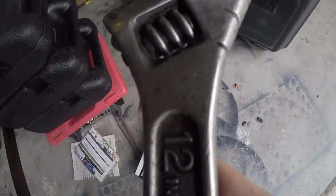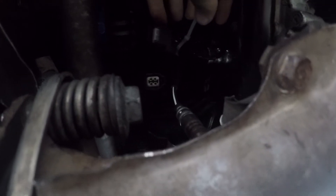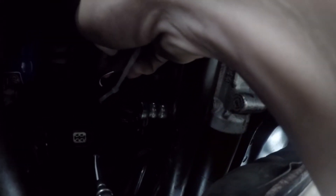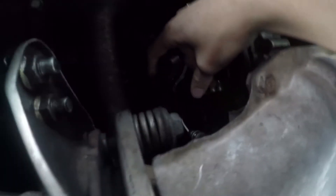We got this monster dealie here and this guy. Let's go see — right there. As you can see the wire goes up. It's clearly zip tied and disconnected too. We're going to use some Eric the Car Guy tips to see what's up with this sensor. I'll give you a quick dirty on it. Basically you've got 4 wires. On this car we have a blue, a white, and 2 blacks. The 2 blacks are the heater circuit, which is what the code is — so the 2 wires are your heater circuit. You need to test resistance on that heater circuit. Basically if you get infinite resistance or if you get nothing, your heater circuit is actually truly toast. If not, then you've got a problem with your wiring.